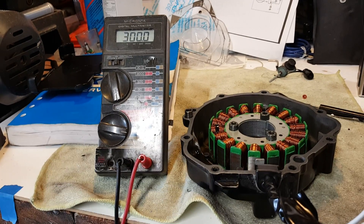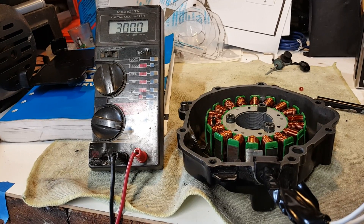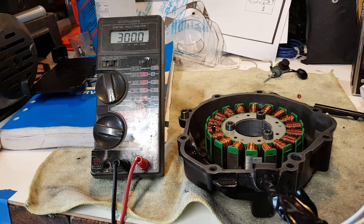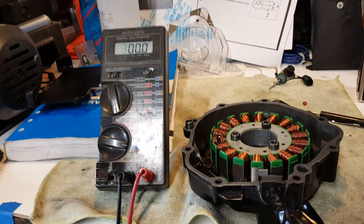So if you're not seeing that in your test, or if you have your meter hooked up to your battery — positive to positive, negative to negative — you start your bike up, rev it up to about 5,000 RPMs, and you're not seeing that 14.2 to 14.5 volt range being dumped back into your battery, then you apparently have an issue going on.